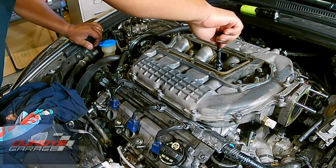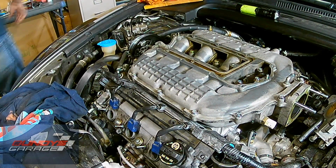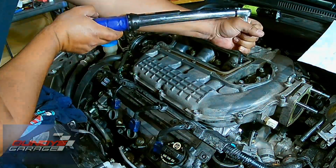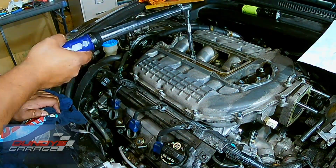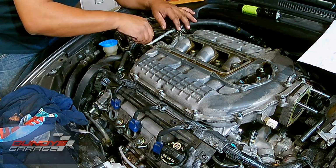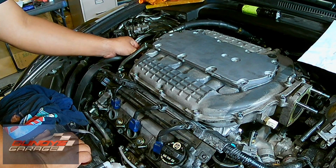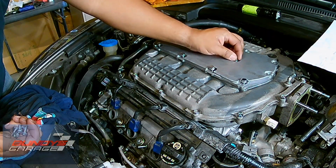So just driving down the nuts and bolts right here on the upper intake manifold. Then I'll come in here, and there's a torque spec for it. I'll put that up. It was right there, but I'll slow that down for a second. 16 foot-pounds, and you just follow the torque sequence. Not hard at all. Then you have a front cover that you need to put on, just attaching the power steering pump. I didn't show you guys the driver's side of this, or I actually haven't done it yet, where I put the throttle body back on, the snorkel.